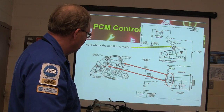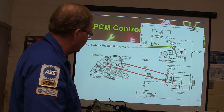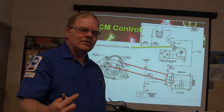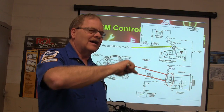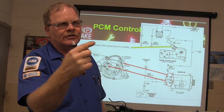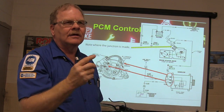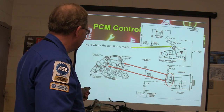The engine controller on some Chryslers also measures battery temperature — there's a temperature sensor on the bottom of the battery tray. A lot of them have inductive pickups around the battery cable so the PCM can read how much current is coming out. Many times they'll use the big starter post as a junction — the battery hooks to it and the alternator feeds charge current to that same post and straight over to the battery.